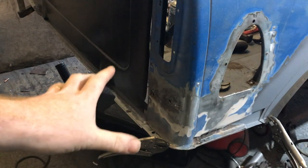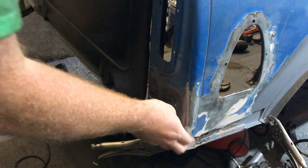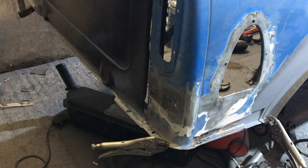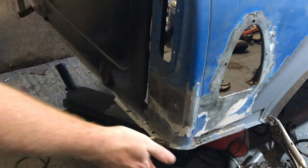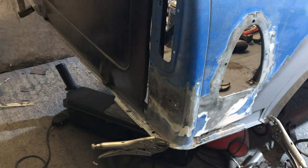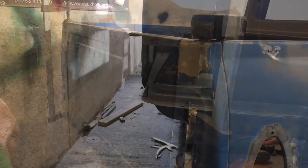We've got both arches in and looking okay. What I'm going to do is try and repair the rear passenger corner next. I'll show you the driver's side — we're leaving that in place. It might well have been repaired years ago when the original floor was there, so it's got a bit of a flange which gives us a datum, a bit of a height. The other side was gone and we've chopped it, so always try and do one side at a time so you've always got something to refer back to, even if it's shot — it helps you control things like tailgate alignment.